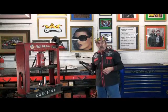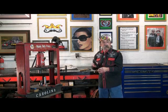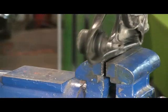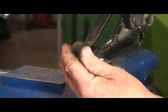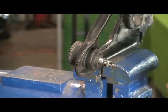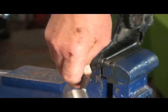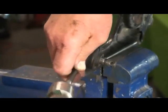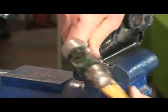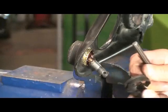The first step in our project is going to be to remove the protective ball joint boot. We're going to put it in the vise and then use a small chisel to pry the boot away from the ball joint. I'm going to go in right between the ball joint and the boot and open it up. This is an interference fit and it's kind of pressed on there. We got that bad ball joint boot off.